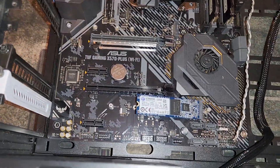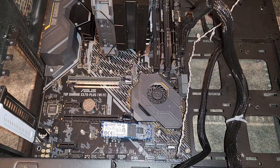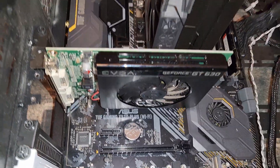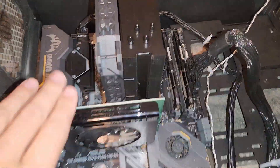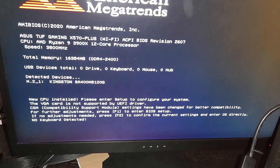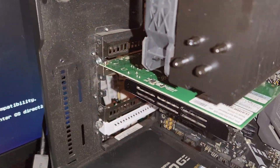Can't find an M.2 screw — no big deal, just leave it out. Got my EVGA 630 in there for display. We're going into BIOS to overclock the CPU, and then I pop the GPU out and run it as-is. And we have POST — it wasn't posting at first but the CPU was just slightly loose from the way I had it installed.